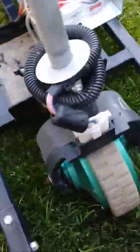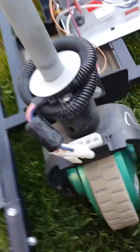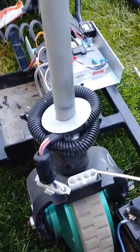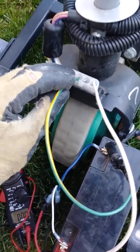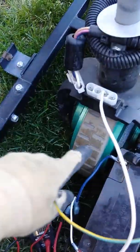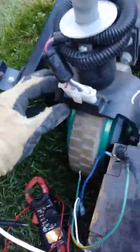What I've got here is an extra battery. You stick your positive on, try it again, and your negative — I'm getting about 11 to 12 volts trickle. Now, when I was using the lever it wouldn't do anything. So for diagnosing purposes, I put my meter leads on and it wasn't getting a positive-negative signal. When it reverses, it flips the polarity to make the motor run — it might be signal wires or a ground issue to activate this.